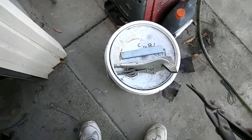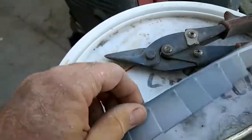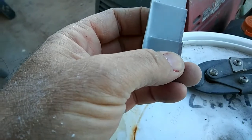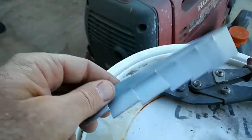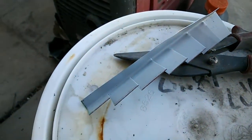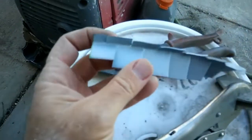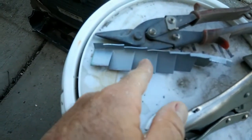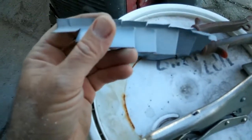First, you cut a bunch of series of lines here. Now, pie cutting would actually be cutting a pie-shaped piece out, but we're going to cheat a little — I'll just leave it overlapping. I'm going to show you how to double pie cut this piece because it has to fit in at a compound angle. It's a really tricky pie cut. Notice I staggered everything — this edge is between the two pie cuts so that you still have some strength in the metal.